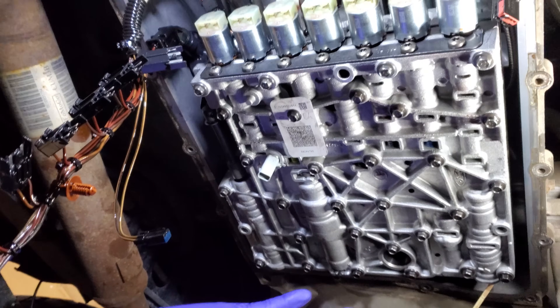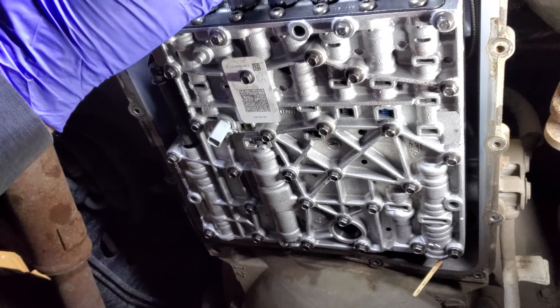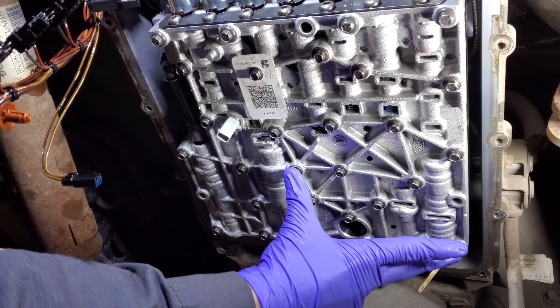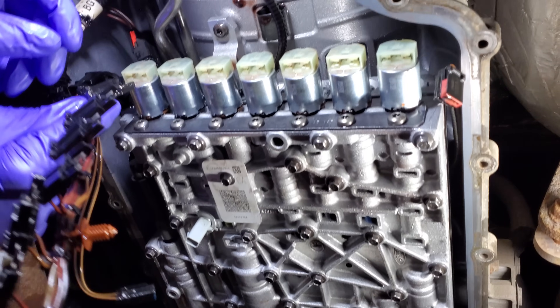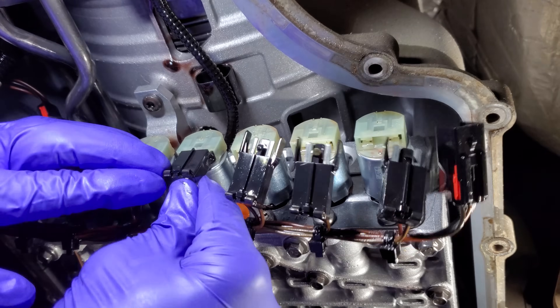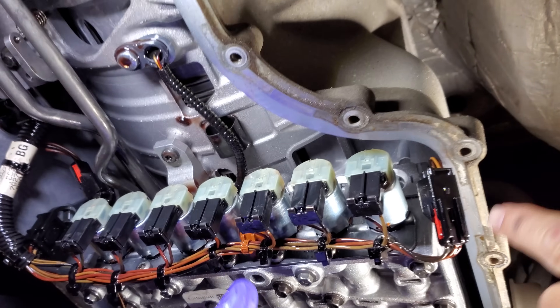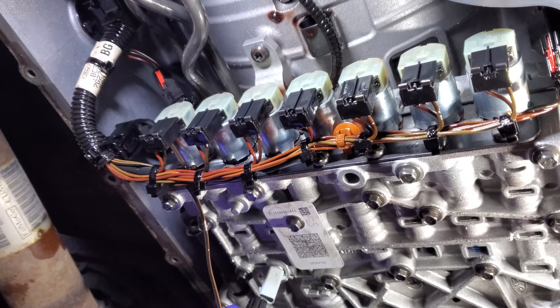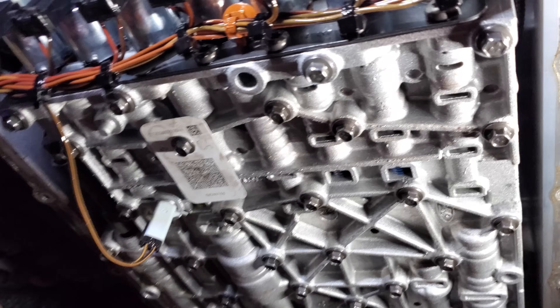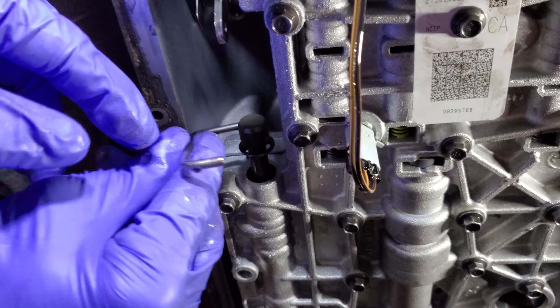The valve body is in — it was really no big deal to put in. Looking at the parts description in the description, you'll see all the squishy O-rings you're going to need and the seals. Just three bolts holding it on — these three right here. Now one of the final things we're going to do is connect every single one of these shift solenoids. Looks great. We've got our TFT sensor — got that — and then we have our shuttle connection for park.